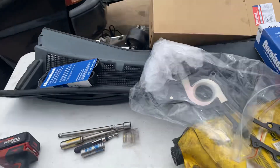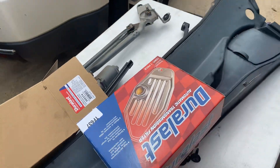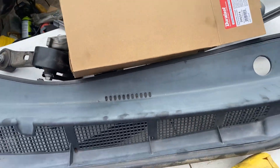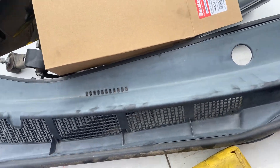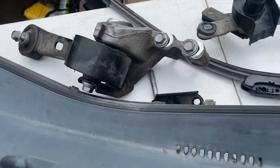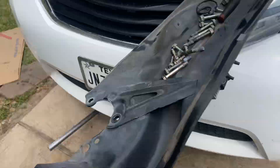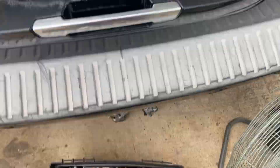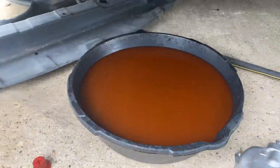Here is the plastic cover. For that you've got to remove all this. Then you've got to remove this motor mount that is on the corner. You also have to remove this motor mount bracket that is on the side.